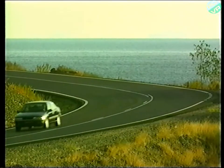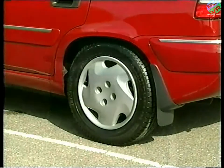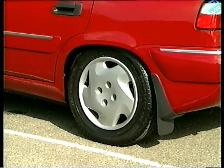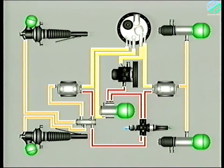In this final part of the program, we'll look at some refinements to the system. A well-known characteristic of earlier cars was that the suspension would sink overnight. So to overcome this, Citroen now fit anti-sinking valves between the safety valve and the height correctors.